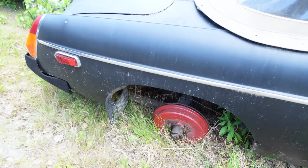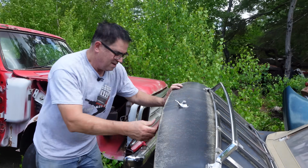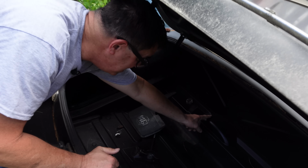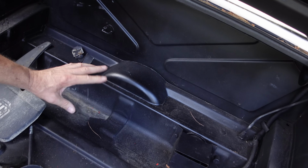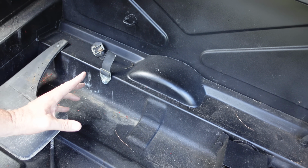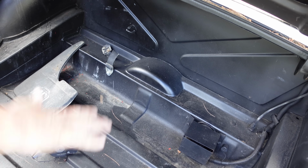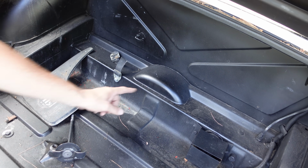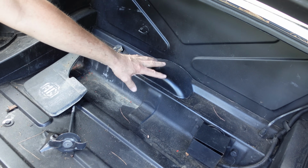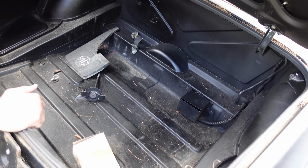That something is this weird bump right here. I believe seen on 1966 up, because again, the GKN rear axle being larger than the one that came before required this bump. So at full rebound, jounce and rebound, the axle wouldn't smack into this. So it's kind of interesting how MG had to sort of adapt to the various things that were added to the vehicle.